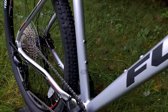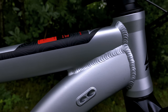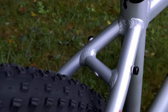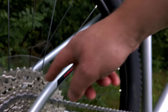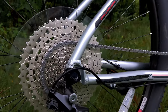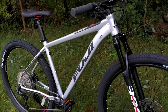The Nevada is made out of Fuji's A2 SL Aluminum, which is Fuji's way of saying it's a custom-butted alloy frame. It's going to have pretty nice welds, an inch and an eighth head tube, internal cable routing, and a nice quick-release 30.9 seat post diameter. Out back, it's going to have rack mounts and a spot for fenders. The frame utilizes quick-release 135mm hubs out back with a threaded bottom bracket in the center, and up front, 100mm of suspension travel.